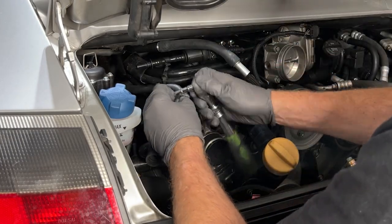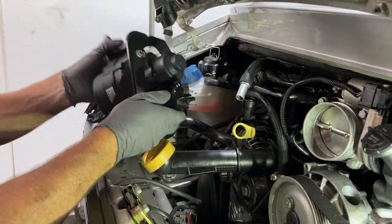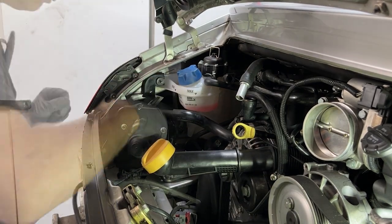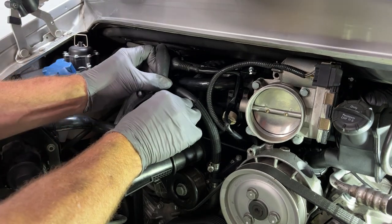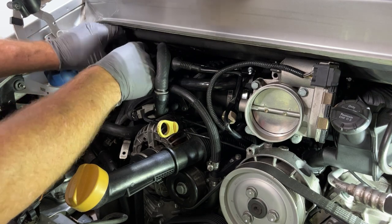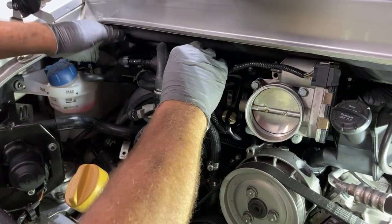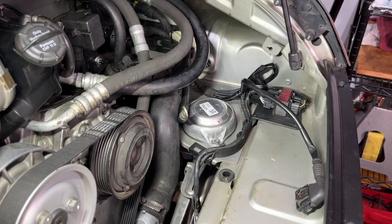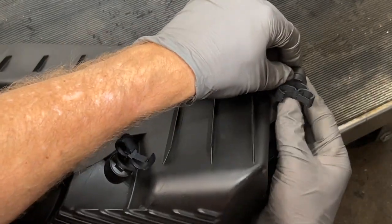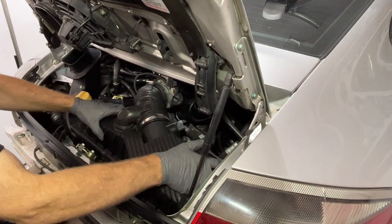You can see the hose from the heat exchanger coming all the way from the other side of the engine — we're putting that onto the expansion tank. Here I'm putting on the secondary air blower, essentially a large hair dryer for the engine. Next up is the brake booster hose — those of you familiar with Porsche will know that hose at the top is a generic one from the local store; there's still a bit of a mystery surrounding how it got broken. Here I'm connecting the regeneration valve to the car's fuel system, the passenger side O2 sensors are getting connected, and I got new clips for the mass airflow cable on the air box. Taking the engine out a second time did result in a few bits and pieces getting taken care of now rather than later.